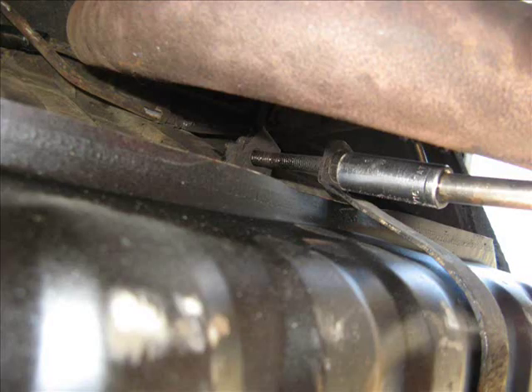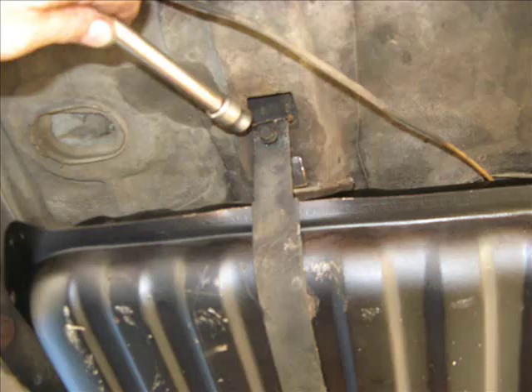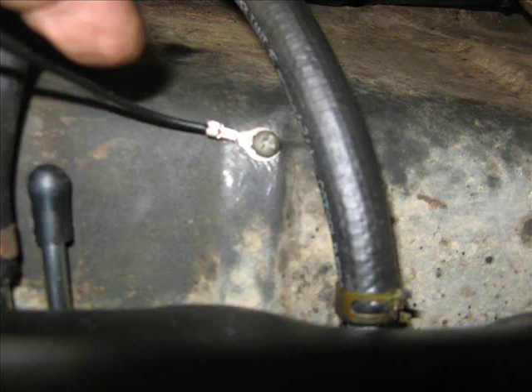Use a socket and extension and tighten the bolt that holds the band around the gas tank to the body of the car. This is the same thing but on the passenger side. On the rear of the tank there's a bolt on each strap, on the two straps that hold the tank to the back of the car. Now this is the connection for the gas gauge. You'll see there's a little hole for the grommet to hold the wire to the frame. On the front of the tank, this is the ground — this is what completes the connection so the gas gauge works.